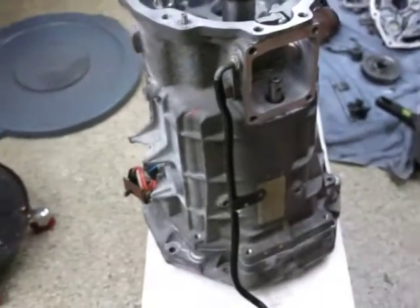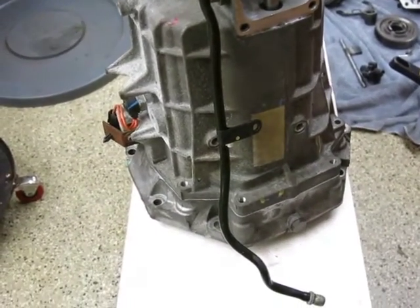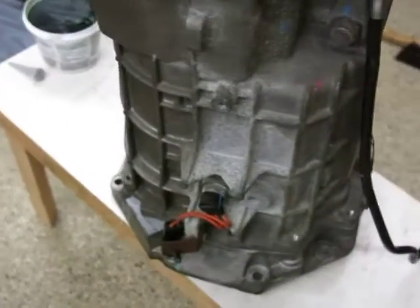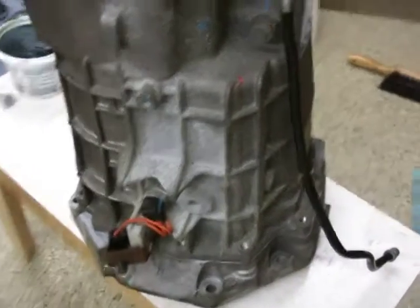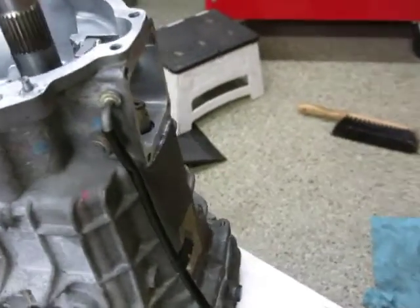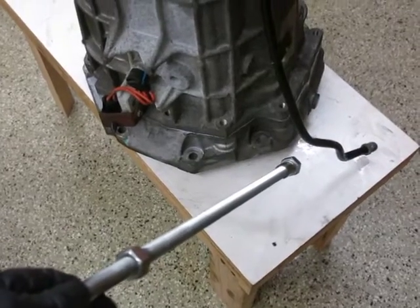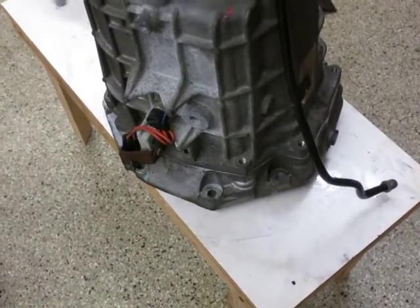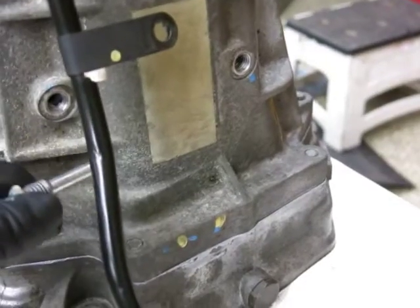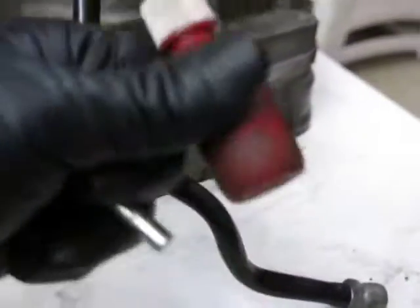The main case is on. I'm going to lift it up a little bit, tip it over slightly, and install some of the screws from underneath to hold those pieces together while I finish assembling it. Then I'll rotate it on the table so it's sitting flat again and all the holes line up at the bottom, because I'll want to install my threaded rod again for adjusting the countershaft extension clearance. Next up is to put the shift rail bolts back in these two holes, but first we're going to add some Loctite.